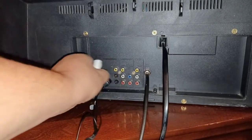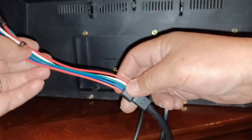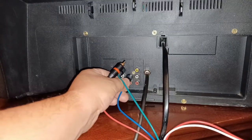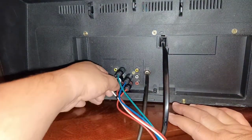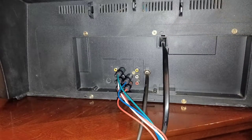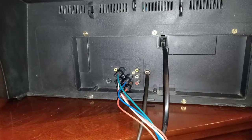From there, if you want to upgrade further, you can actually leave the S-video hooked up and just switch between feeds with the remote — useful if you want to compare color schemes. But for the sharpest image, switch over to component cables. Hook them up by matching colors: Y goes to the green (yellow) input, then Pb to blue, and Pr to red, plus your stereo audio. Whether the cables are all in-line or separate, as long as green-to-green, red-to-red, blue-to-blue — you're good. Then use your remote to cycle through input feeds 1, 2, and 3.